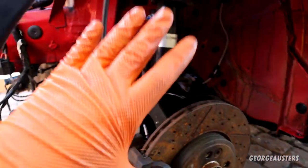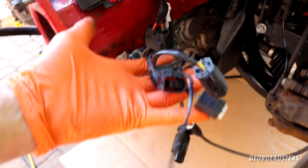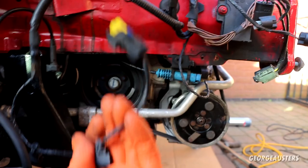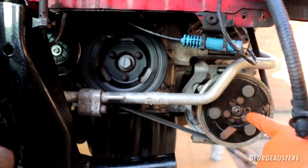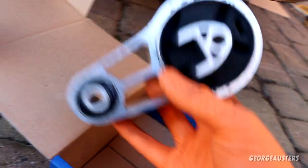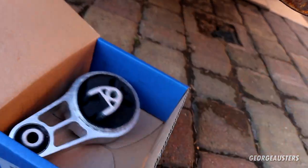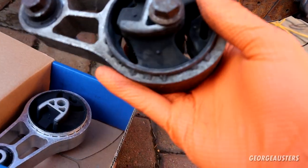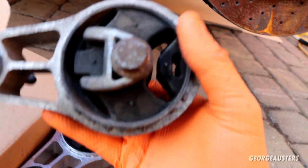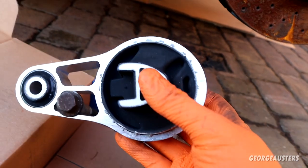The connectors in the wheel arches are for the fog lights, headlights, washer bottle, and similar. On the other side there's the ABS sensor and the connector for the AC compressor. Now that the drive shafts are in place, we can install the new rear engine mount — genuine, wasn't expensive, but worth replacing as the original has cracking around the edge and a bit of movement in it.